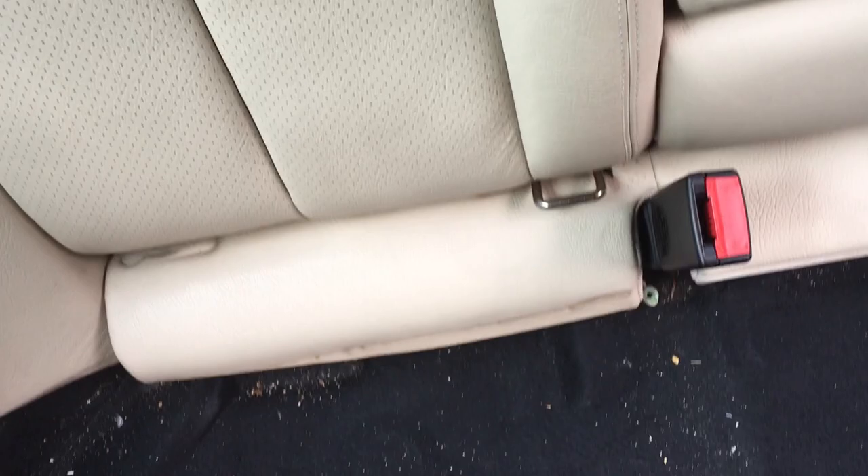To get access to remove this panel, I can't just tilt the seats forward - I'm going to have to remove the back of the seat. To do that I need to remove this cover here, which I think is screwed on. Then I can remove those, and after that there should be bolts underneath that will remove the seat back. Let's go on to that next step.